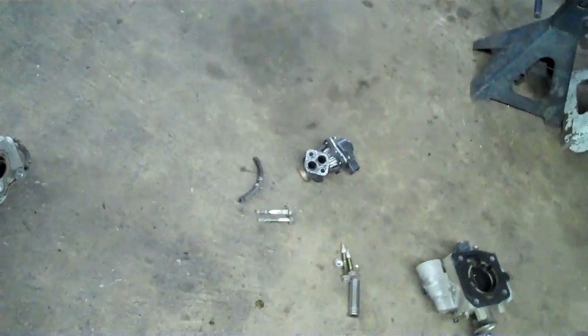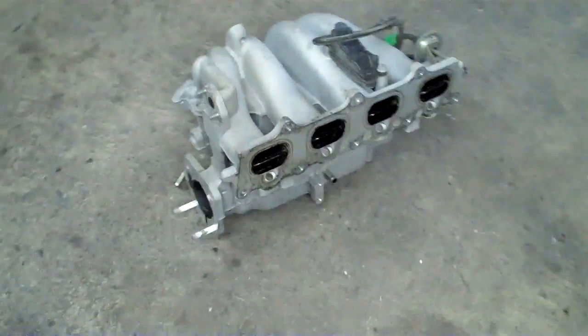Long story short, now that it's back in here again with the most recent development, I look into it. I just pulled the whole intake manifold. It would be good to clean the throttle body — it's just gross. Both sides are just totally full of crap. The air filter's clean now, but when you look inside where the throttle body was, turns out I didn't necessarily have to pull the whole manifold, but I'm kind of glad I did anyway. See, the EGR valve mounts here on the back side underneath.